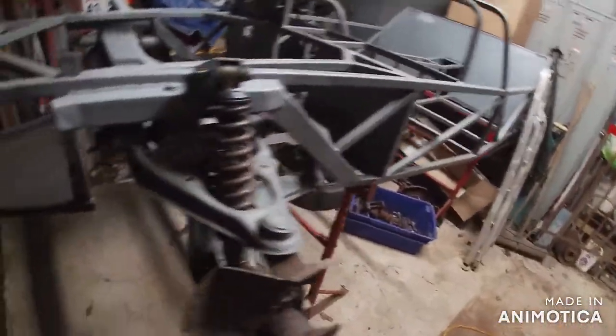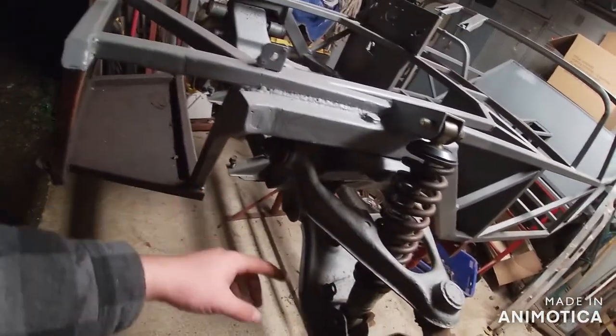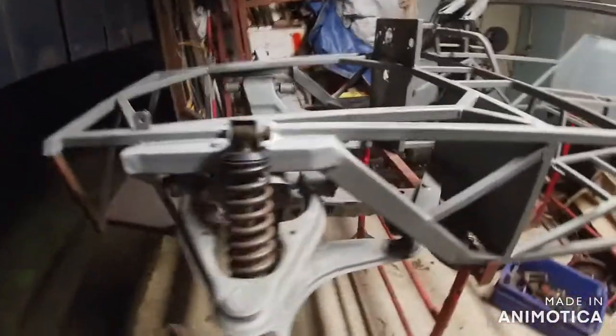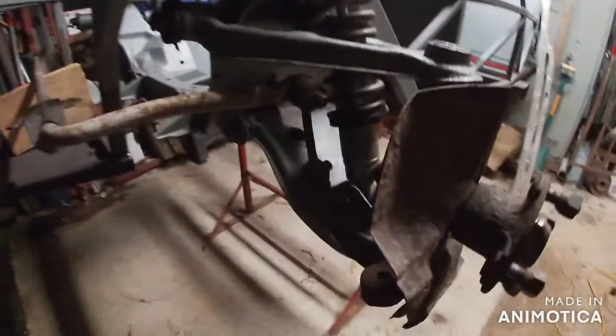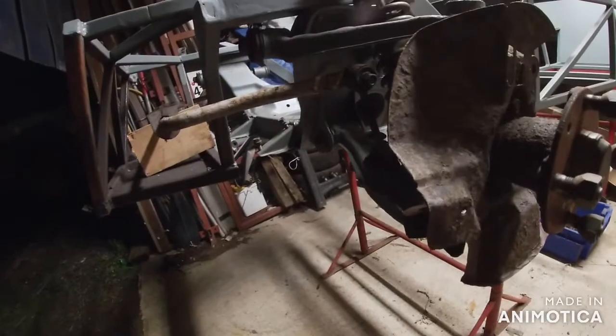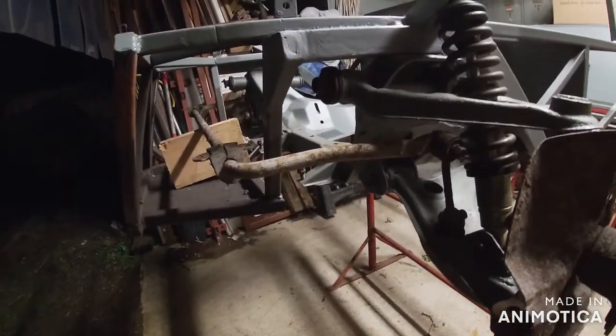So I'll find the drop links in that little box, get them on, get the anti-roll bar sorted out where it needs to go and how I'm going to mount it. Right, that's the front anti-roll bar mocked up now. The drop links are screwed in, just a little bit of an angle downwards, similar to how they are when they're in the MX-5.